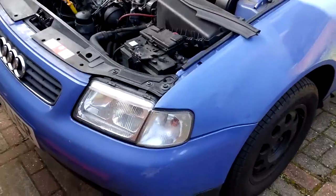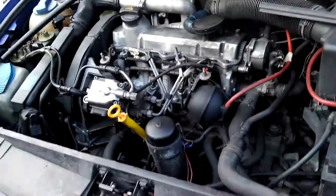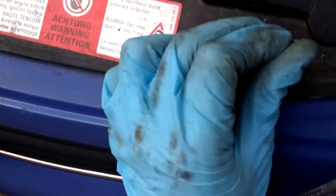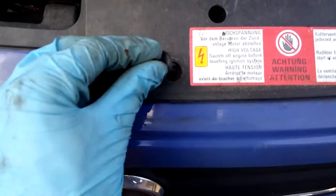Pop the indicator in as well. You might want to quickly test that because if you have a wheel arch liner you're going to hide it away from yourself. We're fitting the two torx screws. One thing you could do — depending on how far you want to go — is add some special coating like wax oil to the inside of the wing; it'll make a mess if you go back in there but it will inhibit rust. Now we've got that done, we're putting the bumper back on. I've already pulled it over the sides and clipped it on, and we're going to put these rivets back in on top — line up the holes and push them down.